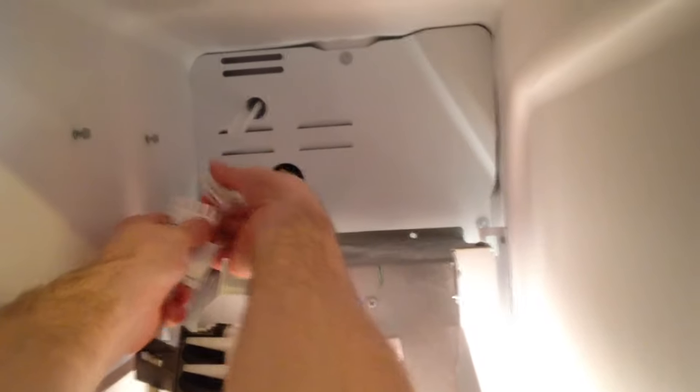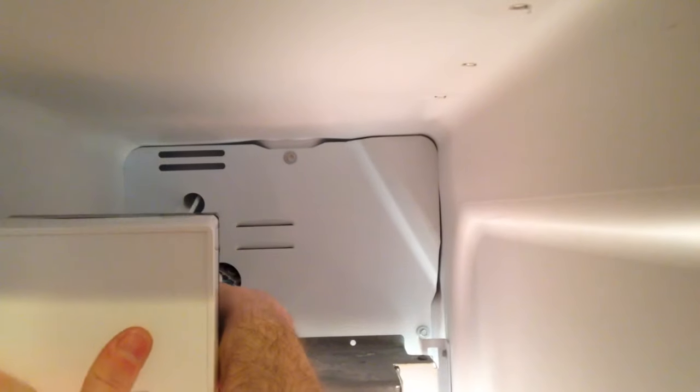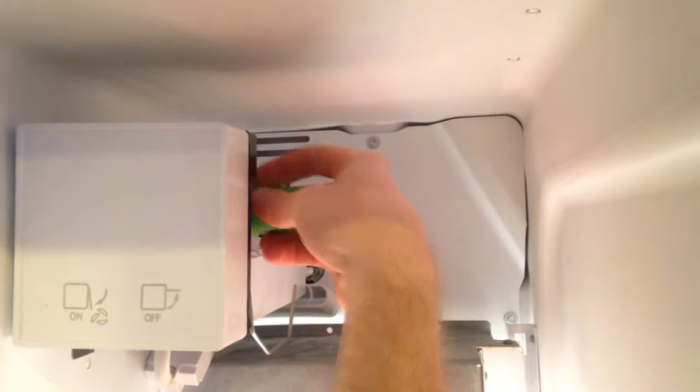Alright, come back in. Same thing — you'll see there's a little squared-off part, it's hard to plug this in wrong or backwards, it just lines right up. Clip it back in, loop this back on, put the filler — the water comes in right there — and hook it back onto the screws. Push it down, then come back in against the wall where those two screws were, as I showed you in the beginning. Tighten those down just until they're snug, like that.